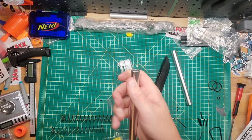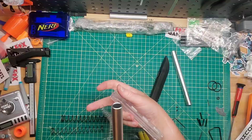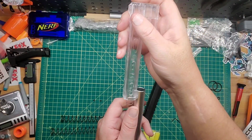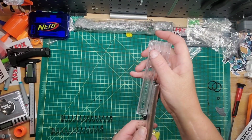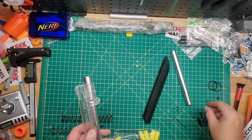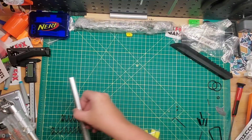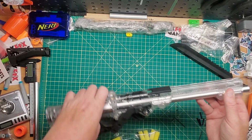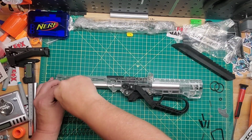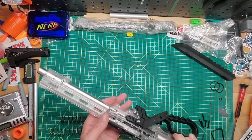Put this side in just like so. Make sure that's on. Make sure your follower spring goes up in the top there, just like so. Everything goes back the same. And now you can put your 4 screws in and your rubber blade back on. So I'll do that real quick here. Alright, once you got those back in, you're good to go on both sides.